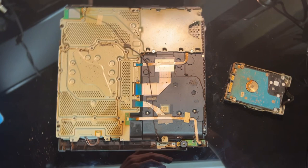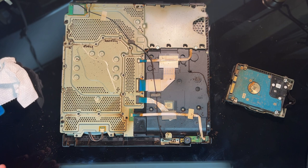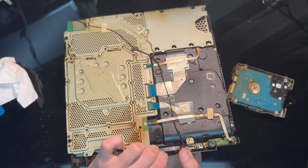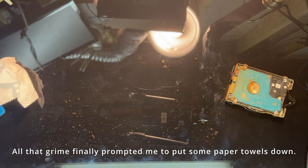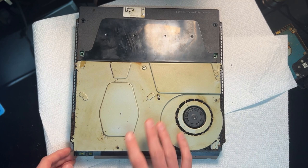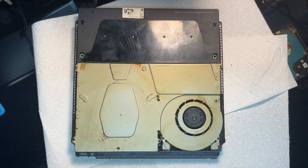You may be wondering why this console is so infested with roaches, and why it was one of the first things I suspected when seeing its nasty outside. The reason is the heat the consoles give off — it attracts the roaches and helps them incubate their eggs so they can hatch more little roaches to go scurrying about. The modern consoles with their always-on standby features don't help the matter any. The consoles are constantly drawing a bit of power and therefore constantly generating a bit of heat. This heat attracts them like a moth to a flame — they climb into the power supply and all through the console. Eventually they will walk on something they shouldn't, usually a capacitor, and it will short circuit — and that will be the end of them, and possibly the end of your console.